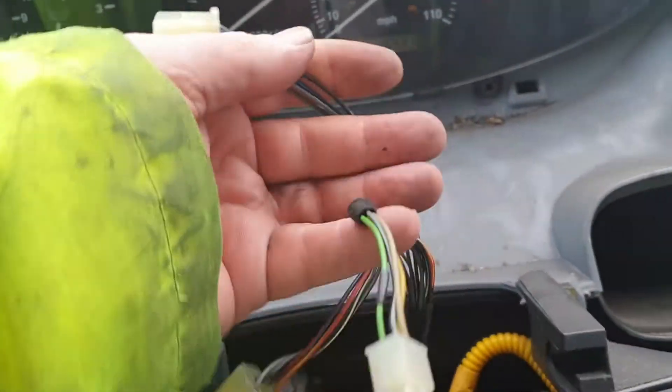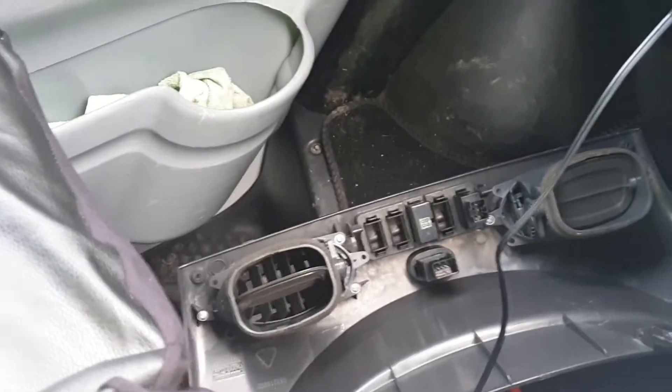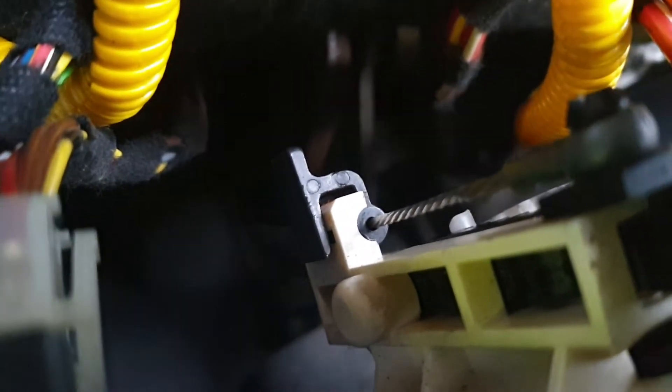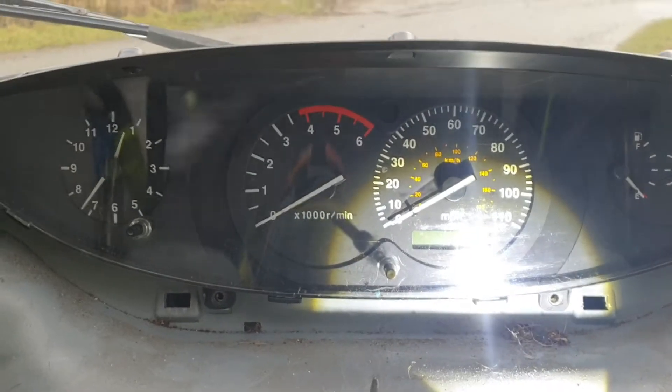To give better access, there are three electrical connections on the back of the unit, so it's easier to disconnect those as well. The other thing I found is this tiny little piece of black plastic - that is the cause of the heater cable failing all the time. That little black plastic clip in the centre holds the cable, and when it pops off it allows the cable to buckle and the switch to fail. I've put it back in place and I'm going to put some copper grease on the cable to help. It's a really crappy design.